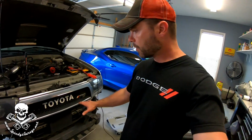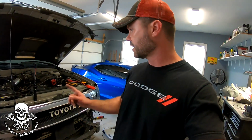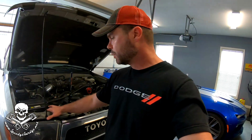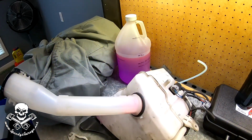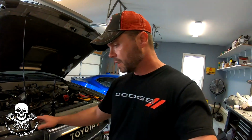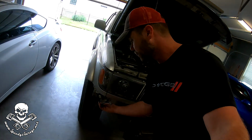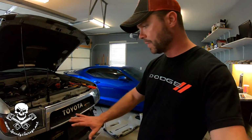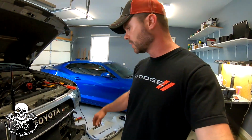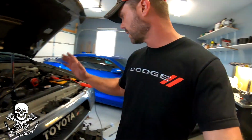So I've got the front bumper off. I've gone ahead and removed the pump. I did determine that was what was wrong, and I'll tell you how I did that. I drained the fluid from the reservoir. I used the factory washer fluid as my meth injection reservoir. So I drained that. When you remove the bumper, be sure you don't forget to disconnect the turn signal and the fog light if you have it. That was the only thing there. It's like 4 bolts or 6 bolts. Very easy to do. Remove the reservoir, like I said, drain that.